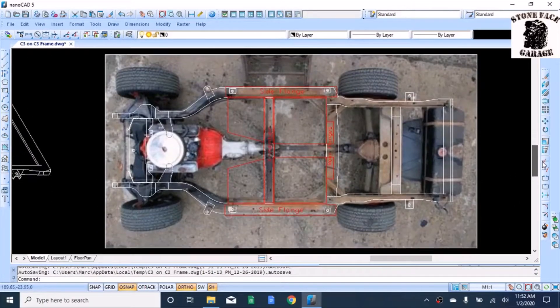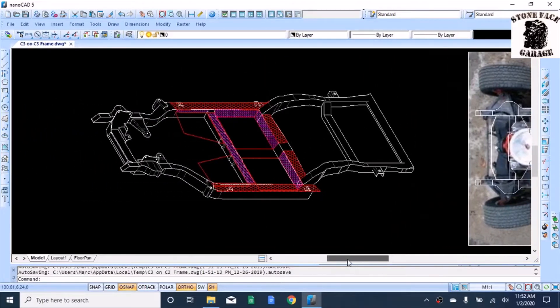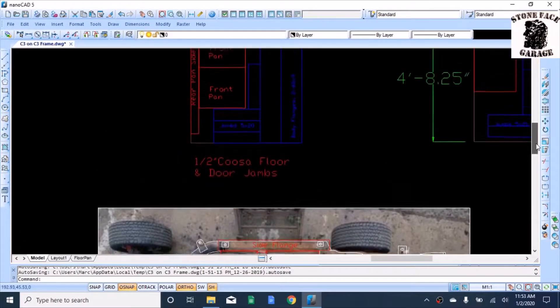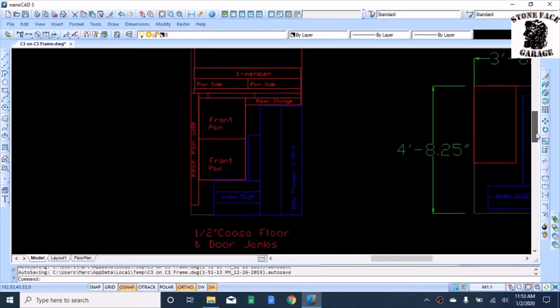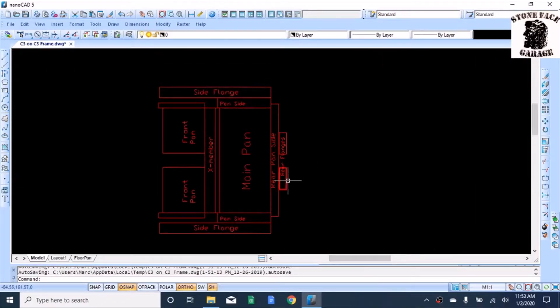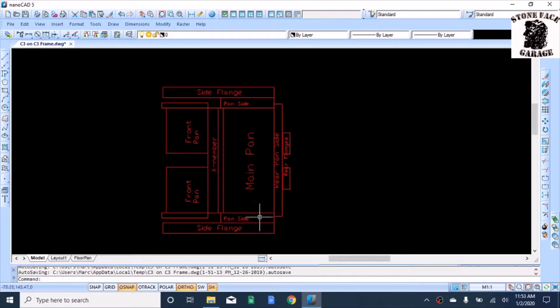I like to visualize it in 3D, so here you can see these parts here are going to be flat on the frame. The pans will be recessed on both sides in the footwell as well, and then there'll be some more vertical or angled members to connect the pieces. That would all be glued up together, making this out of composite material - it comes in a four by eight sheet. I made cardboard templates on the chassis to verify the dimensions. If you unfolded the whole floor pan, this is what it would all look like.